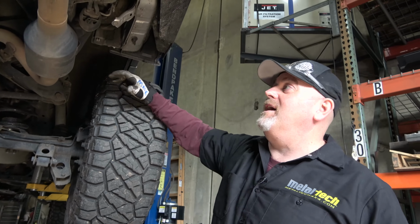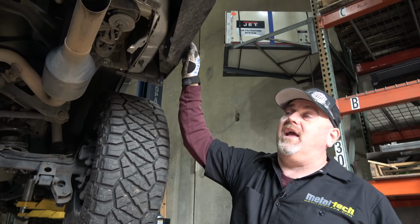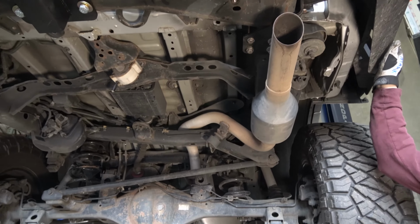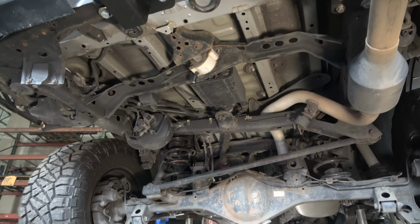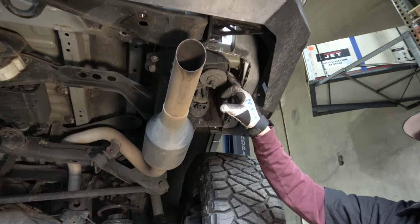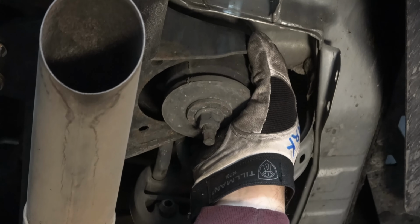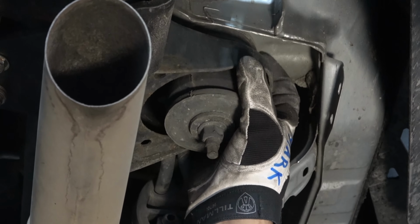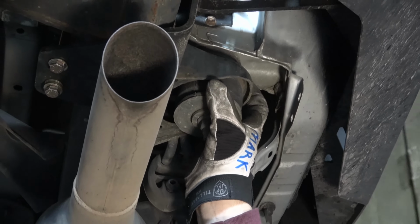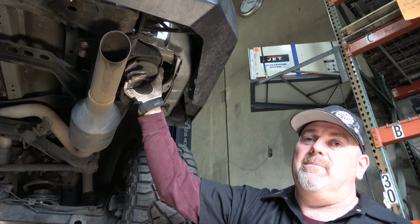We're in the shop and we've got a Lexus GX470 here that has a body that's sitting a little different on the frame from one side to the other. It's actually not very uncommon. The body mounts are these gigantic rubber mounts, and they go into a steel upper mount that they're sitting on. It's not uncommon for those steel upper mounts to get dented inward, or the rubber mounts themselves to get tired and move around, but they're huge. So it's not uncommon if that happens.